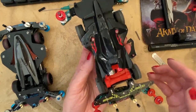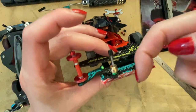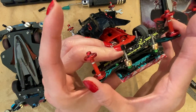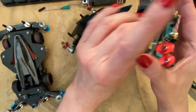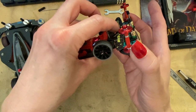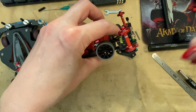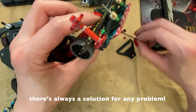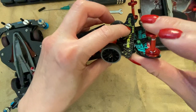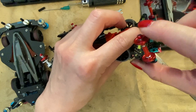Here on Venom, my newest car, we have another pivoting system — I call it the chandelier pivot. The reason why I call it that is because this whole thing basically hangs off of this top plate. I can go left and right, clockwise and counterclockwise. I can go up on each side, down on each side. There's also one point where I really can go up a smidge — and today we're going to be talking about a way to prevent this from ever going at an upward thrust.